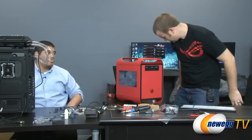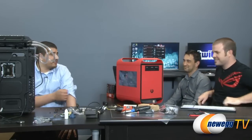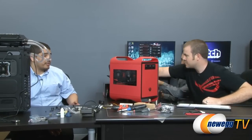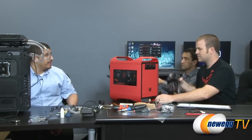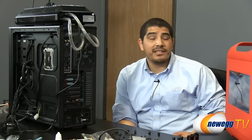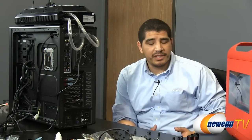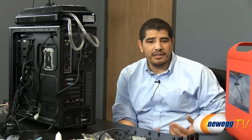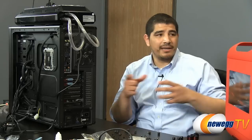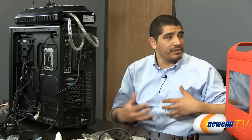Part of that also comes in power efficiency, in terms of how the total power delivery can be manipulated by how we design the overall power topology and implement the power componentry on the card. A lot of people don't understand this, but graphics cards are susceptible to the same type of Vdroop that a CPU is. When you overclock a CPU and the voltage drops, the same thing happens to a GPU. So if you can design a PCB with better efficiency and more consistent voltage power output, and a number of different power topology variables in the total design, then even at the same voltages as another card, you can maybe get better results.